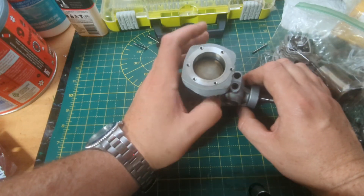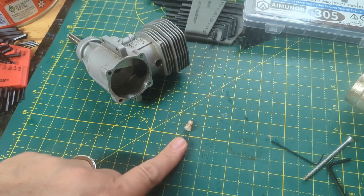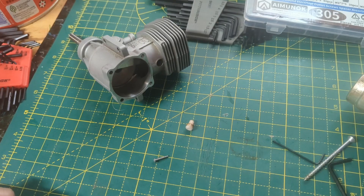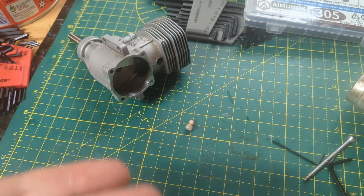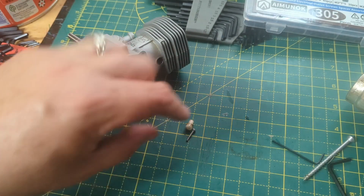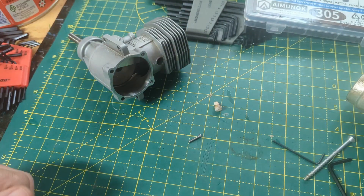Alright guys, thanks for watching. Quick update — I've been working with this and we're still somewhat stuck, but I did find a video on wrist pin removal thanks to David. He recommended using a small screw — thread it into the wrist pin cap and then pop that piece out. I was able to get that piece out pretty easily once I threaded in the screw; a couple good tugs and it eventually came out.